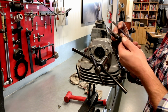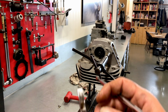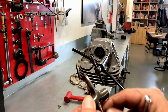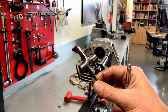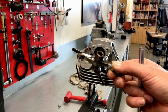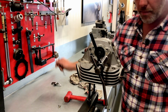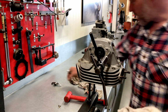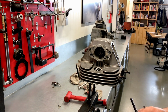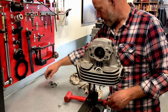And there we have the valve rocker, which has some good chrome surface, some slight wear, not too serious. As you can see, these 1974 and 1975 models, 1976 as well, have these polished rockers, which is nice. Technically not any better than the later ones that are not polished, but nice. And it's original for 1975, and we like original. So we measured the valve clearance before we started the disassembly, and all is correctly set, so that gives us an idea that the engine was looked after. Maybe a little bit too wide, but hey, I'd rather have it too wide than too narrow.